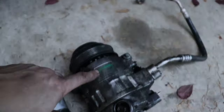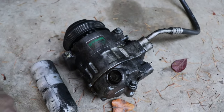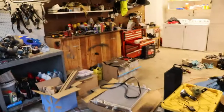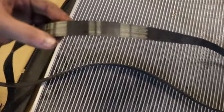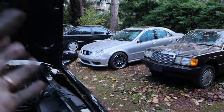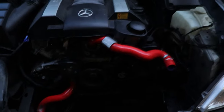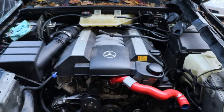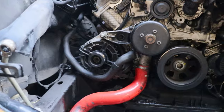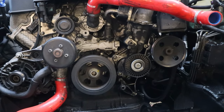Compressor is out — three bolts, not too hard. Big line is tucked back there and the smaller condenser line is tucked there too. Going to hit this with some Simple Green or Purple Power, scrub it up, and pressure wash it. Here's the original Denso compressor and condenser — keeping those as backups for the other cars. The bypass belt you need is 6PK2310 or 4060910 — a Continental belt. That's the same belt used to experiment with AC bypass on the C55.